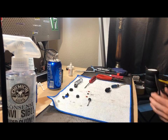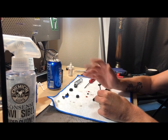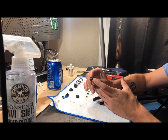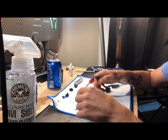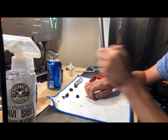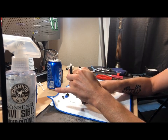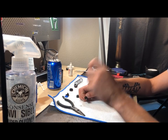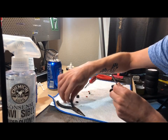Now that we have everything torn apart, this comes the fun part. If you don't have the right tool for it - I've made one out of a flathead screwdriver, I'll make another video on that because I lost my tool. The next fun part is going to be taking the c-clip off. There's two c-clips, one on each side of the piston. So what I'm going to do, since I don't have my tool, is take a very thin needle nose pair of pliers - just go around the shaft on where the c-clip ends are, just push down on that, and out pops your c-clip. Then off comes your piston. Then do the same thing for the other side.